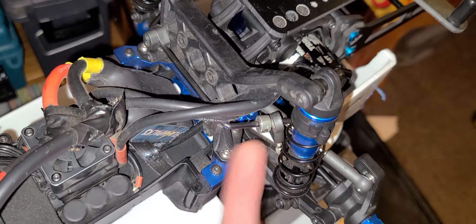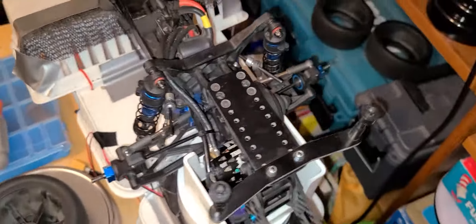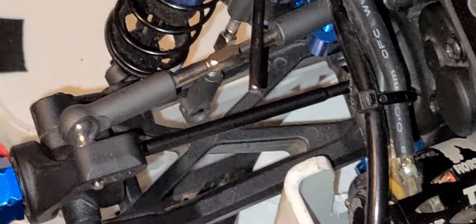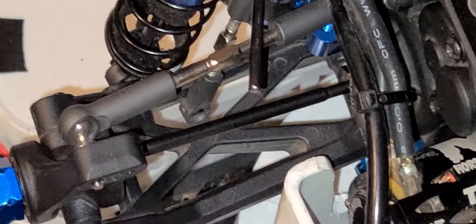What I decided to try was changing the link to the front. I finally did it, and in the process I actually snapped the ball off the back, so keep in mind you probably want to use needle nose pliers or something. If you fiddle around too much this will snap. But moving the link to the front allows you to move the ball forward, and with that it's a lot more responsive. As you can see, when we start moving we're almost getting an instant response. If I moved it a little further up I could probably get it to be really instant.